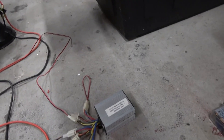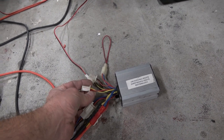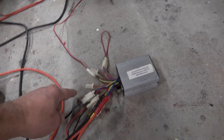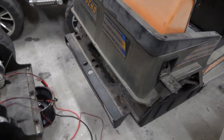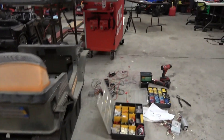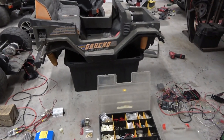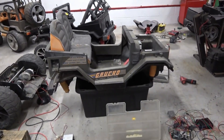There's one connector I didn't mention — it's for brake lights. When the brake is hit, it sends a signal and puts out 36 volts. I'll use a small buck converter to drop that to 12 volts for the tail lights. I'm also thinking about wiring three LEDs in series directly on the 36 volts, which would consume all of it — might try that too.